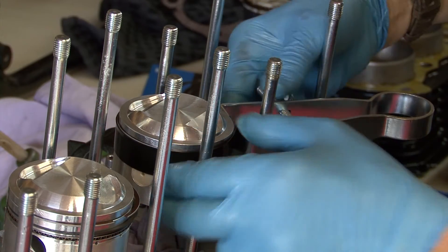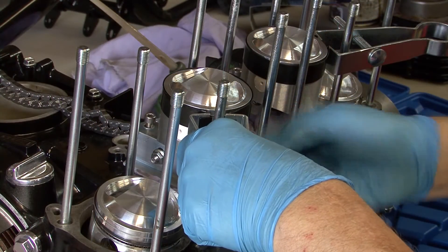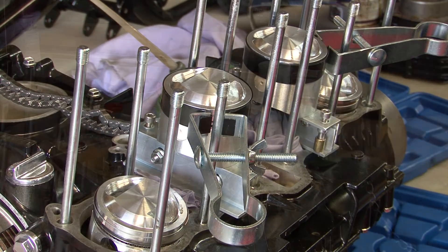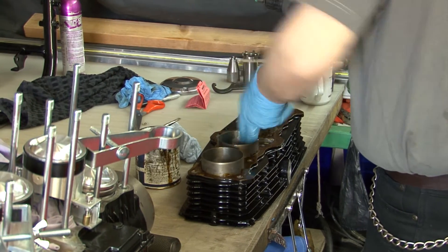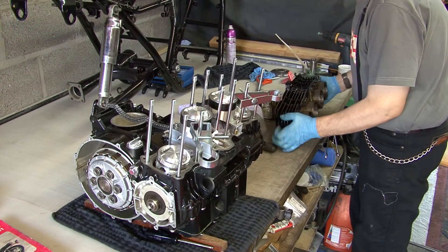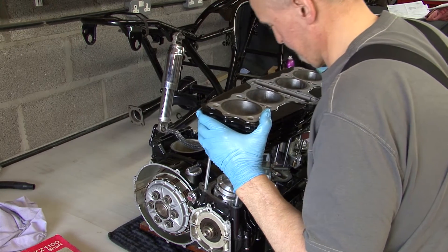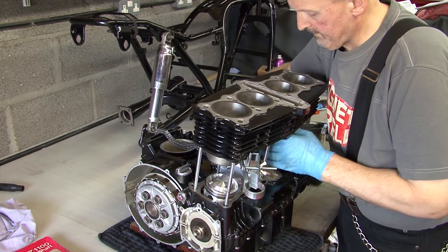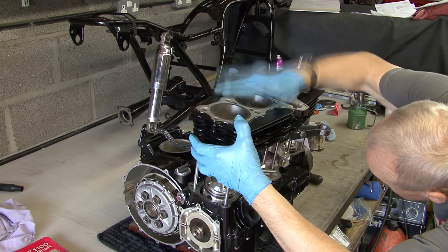Do up the nut until the band will just slide up and down the piston, then fit the second ring compressor tool in the same fashion. Having fitted the base gasket to the bottom of the barrels and buttered it with WellSeal, we now lubricate the bores with oil — this stage is absolutely imperative. In this video we were also evaluating these clamps as well as our first prototype of a tool for holding the pistons at top dead centre. Anyone who has fitted pistons before will immediately see the value of these tools.